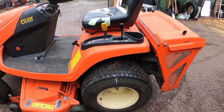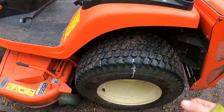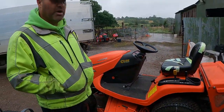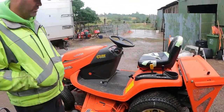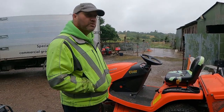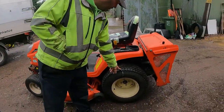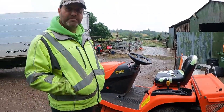When we had the water on the tyre you could see the bubble coming up, where the air was coming out. So it was only a slow puncture, and then you put some Tipp-Ex on there just to mark where it was. Then you put the ride-on away and let some air out of the tyre. Make sure it was on the top as well, then put some super glue on it.